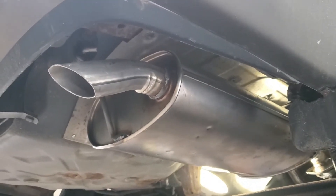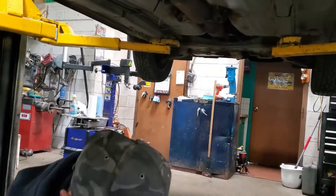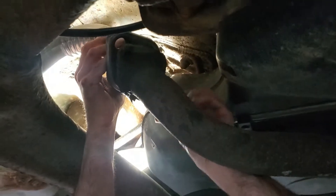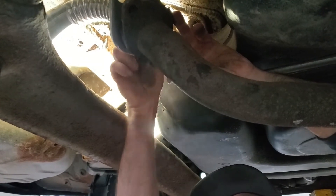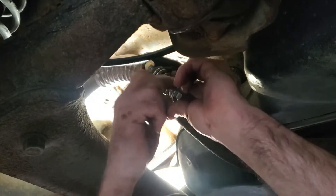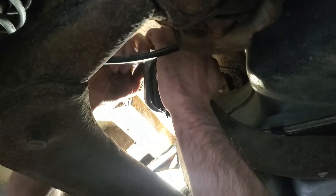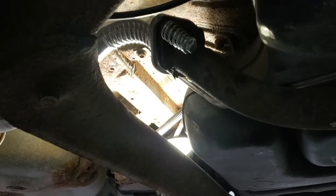So now there's two bolts with nuts and springs, they're going to go in the flange. It looks like somebody's fixed this before. That reaches there — I'm going to start this one by hand. Now because these are spring loaded, sometimes you've got to use force to push up on the spring to get it started to your nut, which is actually not that bad to do. That didn't take long. It seems to be a 14 millimeter socket — I'm going to buzz those up.